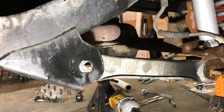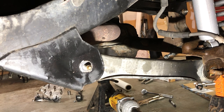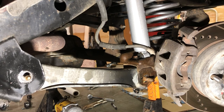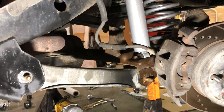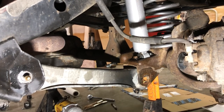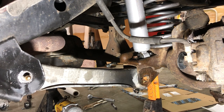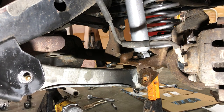All right. Now that we've done that, let's see if we can back this bolt out. It's a square cam bolt inside, so we can just give it some gentle nudging with my favorite tool in the garage. It actually just wanted to come right out. So there we go. Not too bad. Sometimes these are seized up inside. All right, so let's get the back bolt off.